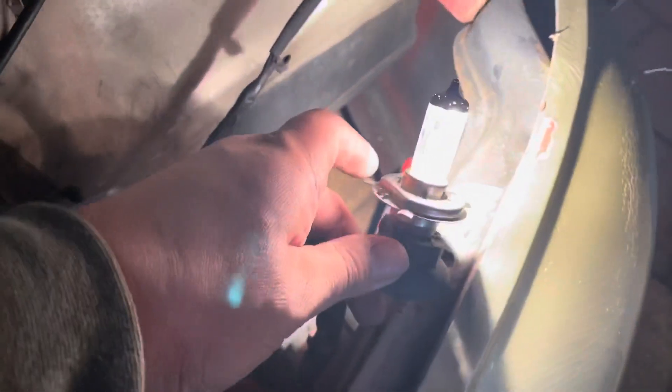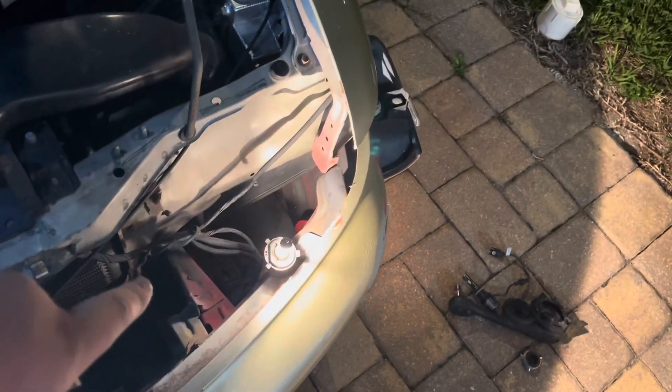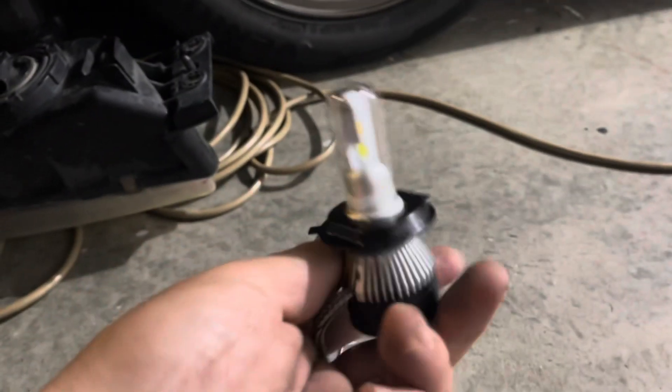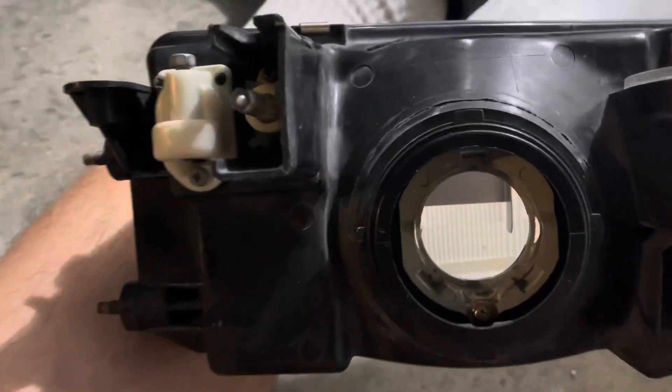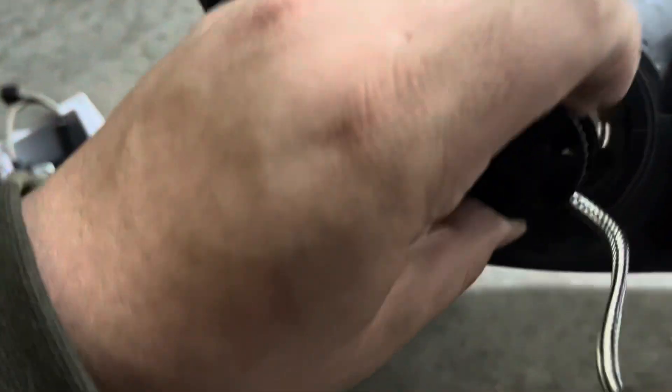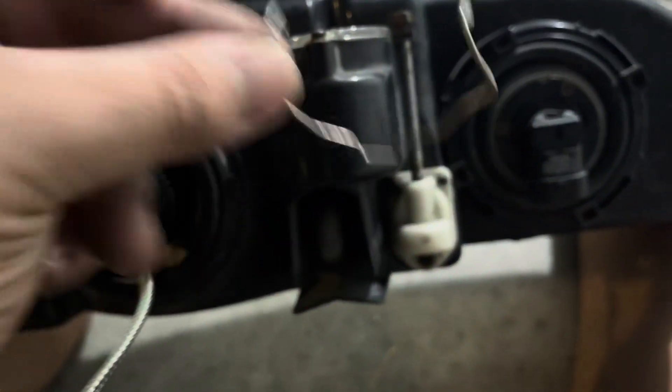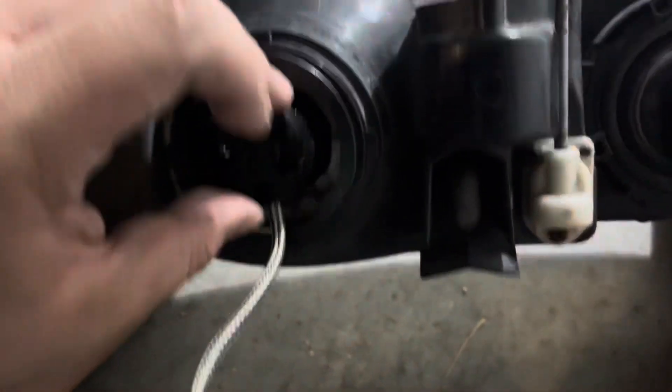Alright guys, so I'm outside at the car. As you can see I took the headlight out just to make it easier for myself to install. So what you're basically replacing with the Bosla light bulb is the old halogens, if you haven't upgraded already. You can see it's not the greatest brightness in the world, and when I switch over to the other one you'll see the difference. But if you have an S14 like I do, it is pretty simple to install — nothing crazy. You can see the three prongs on the bulb, and right here at the headlight you can see it also has three prongs. It's just as easy as slipping it in and it fits. Usually you have this U-clip that you push in and it locks the bulb so it doesn't move around.